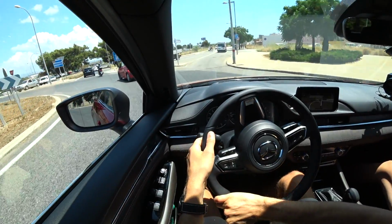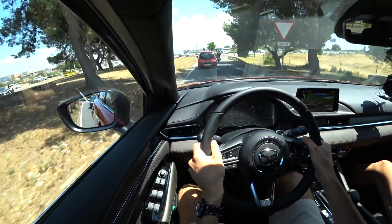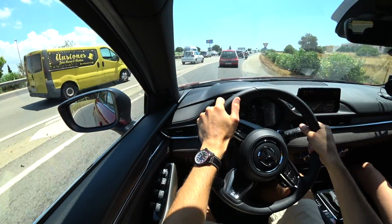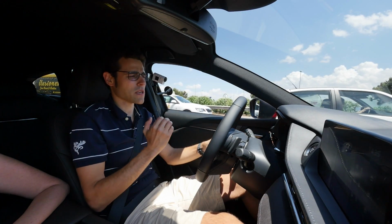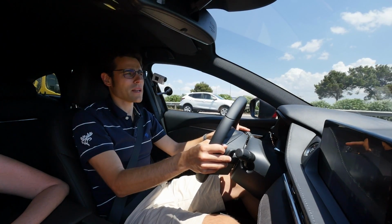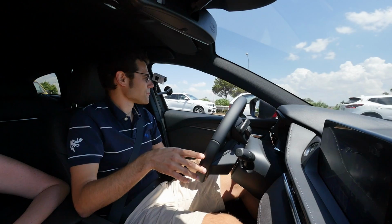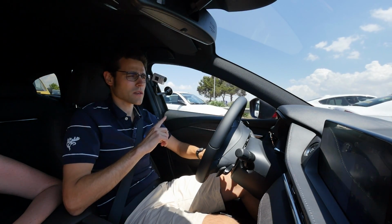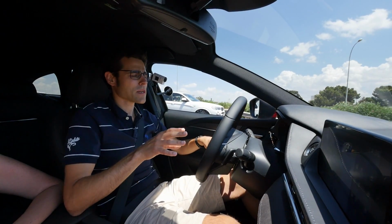What has changed since the last time we've driven this car is that the 2.5 NA has the Cylinder on Demand technology, COD, or Zylinderabschaltung in German. That would be that two of the cylinders are being shut off from the 4-cylinder engine to save fuel when you're just at rolling speed, basically, so you don't need much power. Then two of those are shut off, and this can help to reduce consumption again. But depending on the situation, if you have some rolling, for example, it will definitely help. So I like that they also have managed to make the car a little bit more silent. We've already felt it when going on the motorway a little bit faster, but now also when we're stuck in traffic, with a lot of engine noise around us, the car has become more silent.